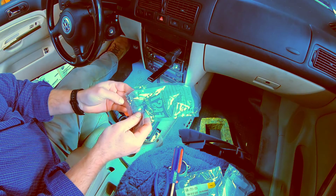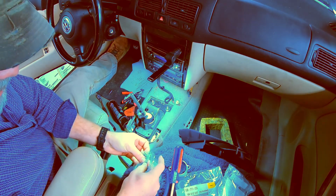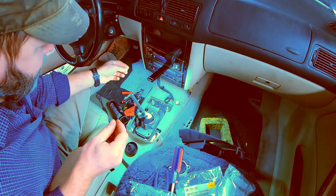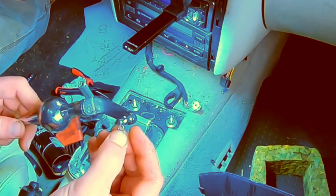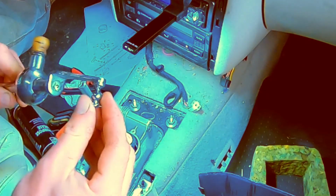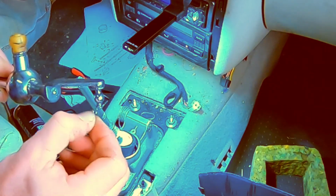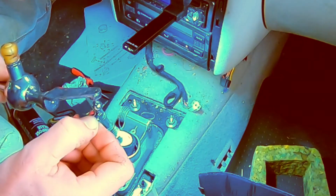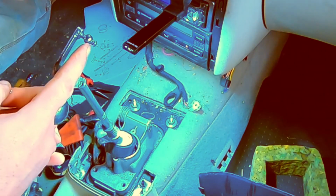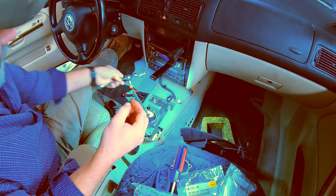Okay, I'm back. Got a couple of replacement screws and also found a possible retainer clip option, which is this little guy. So I got this little clip, which seems okay. The problem I was finding with a lot of the E-clips is that this space here is so small that by the time you get a clip that clips on there very good, it's smaller around than this. And if it could fit on, if the thing slides over this, it's going to slide over a little thing here. So I got this one.